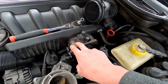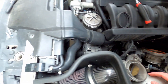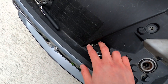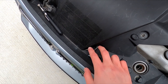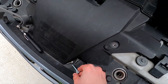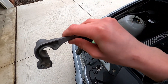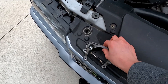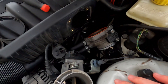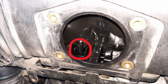Now we've got the throttle body unbolted. Note that with your screws: the two smallest are for the traction control throttle body, the middle-size screws are the bottom two on the main throttle body, and the longest are the top two. This piece slides over the throttle body kind of like Mickey Mouse ears, with two screw holes for the small ones. Moving it over, you can now see your intake temp sensor right there — I'll grab a photo and put it on screen.